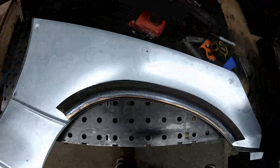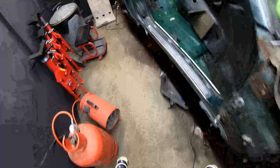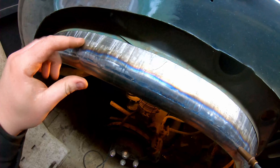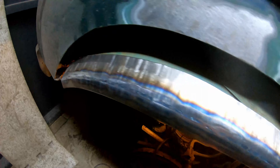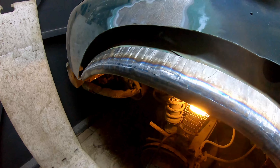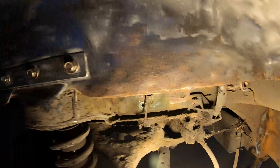Here's the inner arch — just test fitting it again into the outer. It's getting really close now. As you can see with the Cleco on temporarily, it's looking pretty good. There is a bit of a high spot up here and a small gap in the centre, so this needs shrinking a little more just there. It blends in nicely down the back and is really good around the front. I'll have to cut out the inner once this fits up perfectly before I start welding it on. I've been in with the wire wheel and cleaned the whole wheel arch — it's not too bad, still a bit along here, but hopefully I can rust-treat that with the proper rust converter stuff.